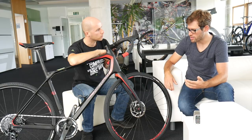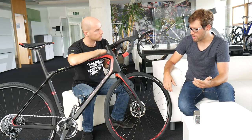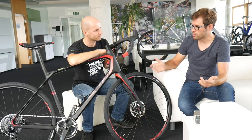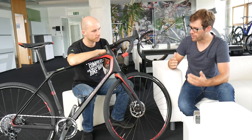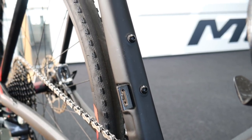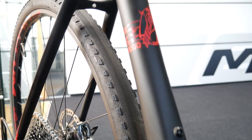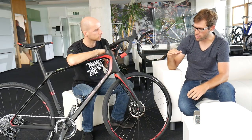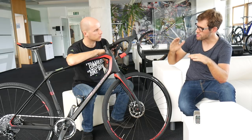With the long head tube, the person on the bike sits relatively upright no matter where they put their hands. Many people on a road bike never ride in the drops — they'd basically be better off with a flat bar bike. But with this bike, I guarantee 90% of people will ride in the drops, which is very helpful on rougher roads. On rough terrain, especially when it gets steep, you only have control in the drops — you can brake with one finger there. On a cyclocross bike in the drops, your center of gravity moves forward and the bike feels very slow, like you're falling over. With this bike, no problem.